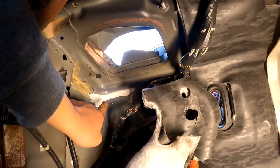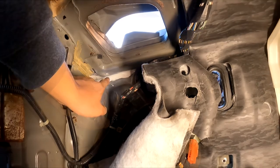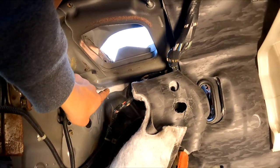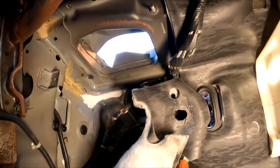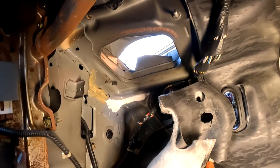In the cabin here, there's actually quite a bit of a cavity in the cracks. So what I actually did, I jammed the nozzle in there. There is actually quite a lot of silicone between the gap. Then I ran it over with my finger just to smooth it off and to compress it a bit. But I am pretty positive that is the only leak and the cabin is now sealed.